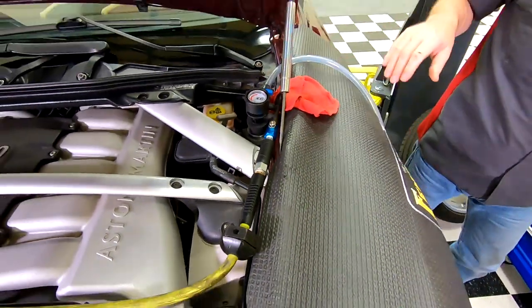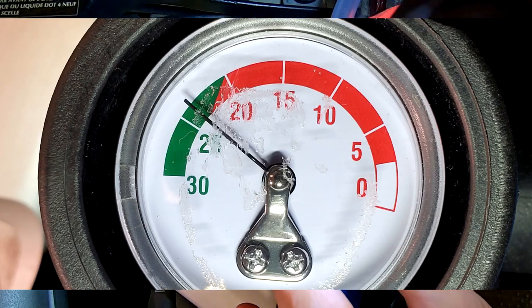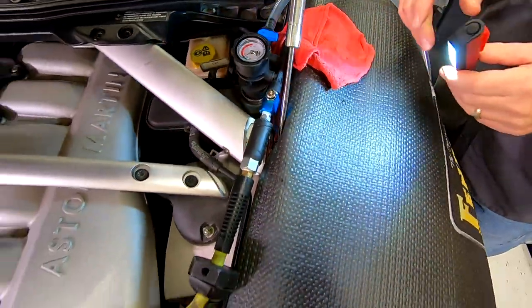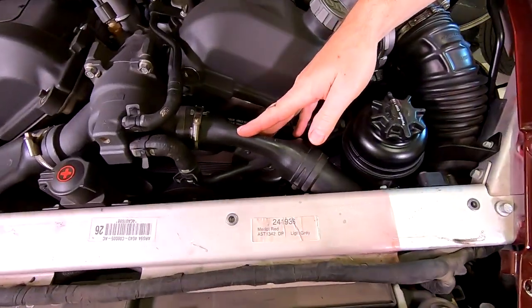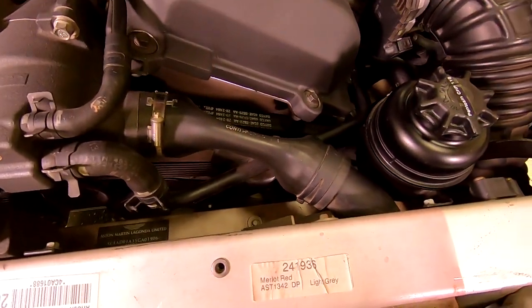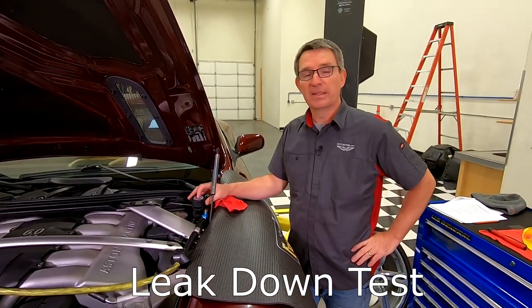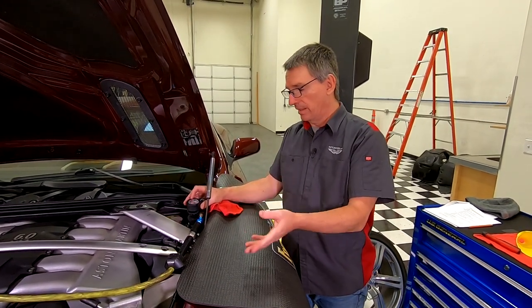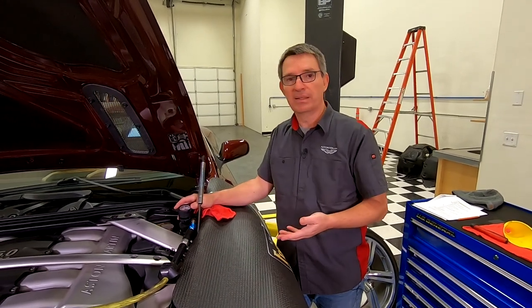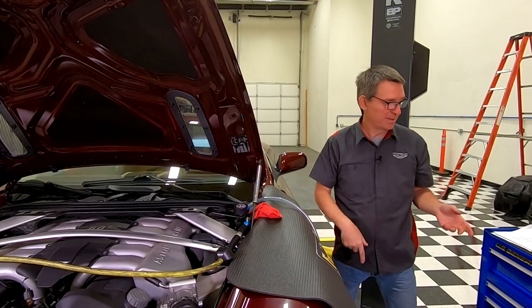That's about as much vacuum as it can manage to pull. Looking at the reading on here, we've got about 24 inches of mercury - we're in the green zone on the gauge. I've got this valve closed to the fill pipe, and as we saw, the hoses have all collapsed because there is literally no air left inside the cooling system. I also decided it was a good idea to let the car sit for about five or six minutes to see if there was a leak - like if the drain plug was leaking, it obviously couldn't hold a vacuum and air would be leaking in. I let it sit a good five to ten minutes, came back, checked the needle - it hadn't moved. So now I'm ready to start air-lifting the coolant up into the car.